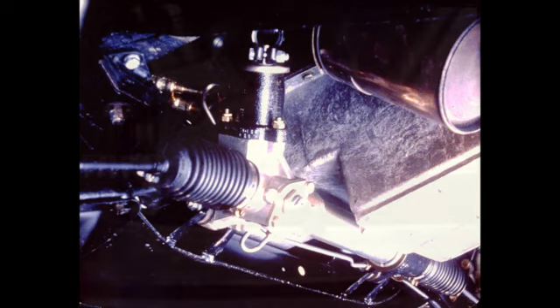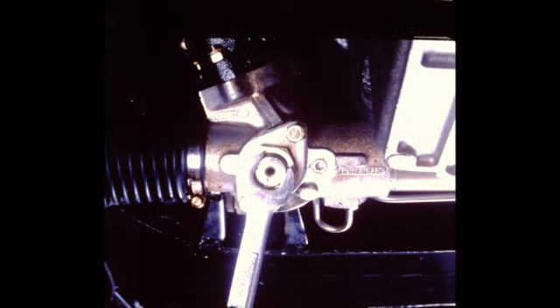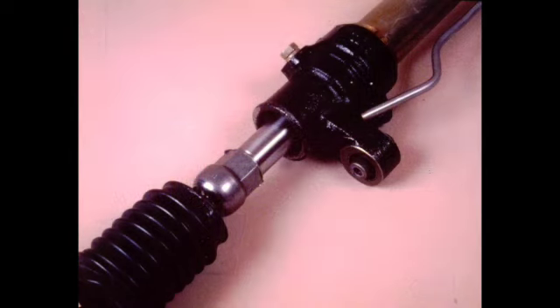Rattling or clunking noises coming from the rack unit should be investigated and corrected before determining that overhaul is necessary. Excessive pinion to rack clearance can cause rattling during operation. Check the clearance by removing the grease nipple or bolt and inserting a dial indicator to contact the rack bar. Disconnect both tie rod ends. Push and pull either tie rod to read the clearance, which should be 5 to 10 thousandths. Loosen the lock nut and adjust to obtain this specification. Wear at the inner tie rod ball connector can produce a clunking sound, requiring replacement of the tie rod assembly to correct.